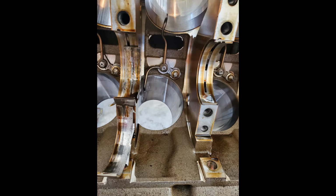The first picture you're going to see is everything already taken apart. It's the crankshaft main bearing, what the crank rides on in the block. You can see the one on the left is pretty beat up, and the one on the right's all right. What happened was the oil got diluted with fuel from cranking it over and over again on the wrong engine harness. So it wasn't firing correctly as to the firing order from the PCM to the firing order at the engine, because pigtails are swapped in F-150 to Mustang engines.